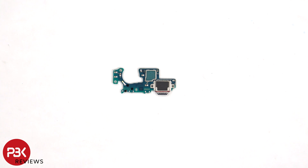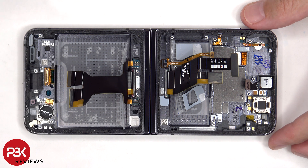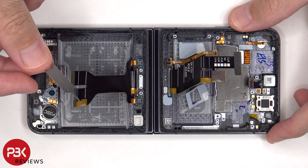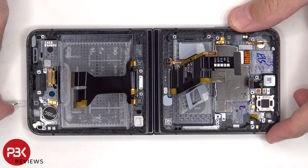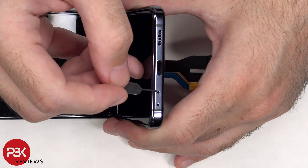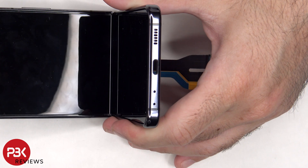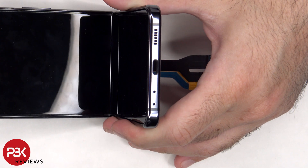Here's a look at the other side of the subboard. There's another rubber gasket and mesh filter over the microphone opening on the bottom, and it's seated above the hole or opening on the frame, so if you happen to accidentally put the SIM ejector tool in the wrong hole, you won't damage it. There is a second hole next to the primary hole for the microphone, and it may just be a secondary channel in case the first one gets clogged.